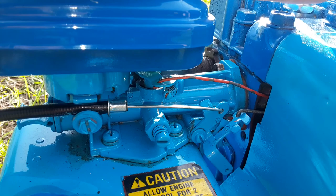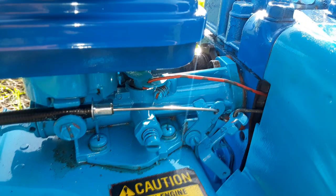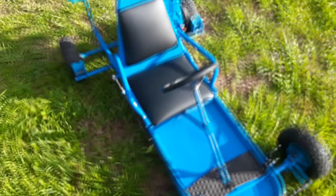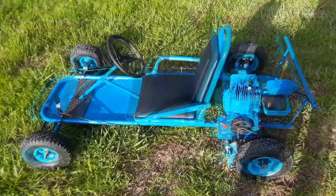Something else I did — I was having trouble with the spring on the governor. I got a rod right there that goes to the governor flap and then to the throttle, and it's just straight wired now without a governor, and it works perfect. Hope you all liked the video — like, subscribe, all that stuff. I do have one more final touch I've got to do, so stand by for that.